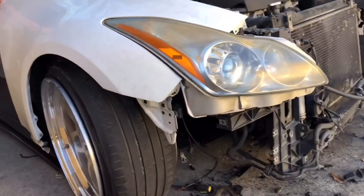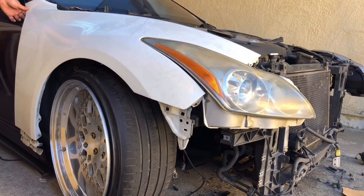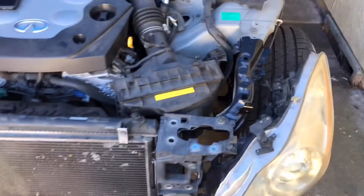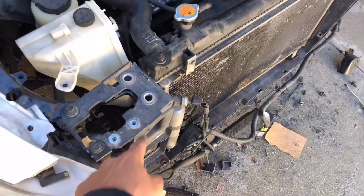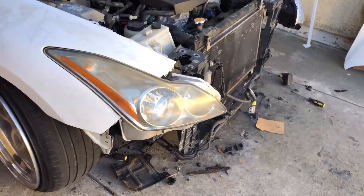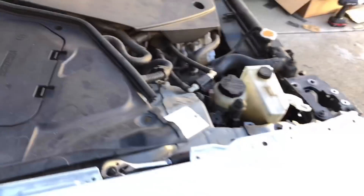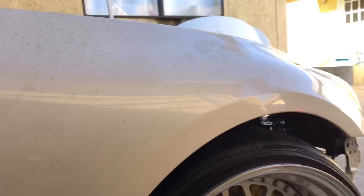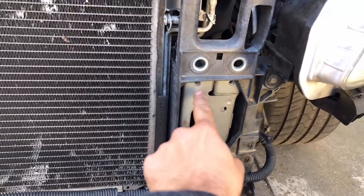Back to some bad news — look at that wheel gap. The fender is on at the front only and it's way too high. The radiator support is too high right now. I'm wondering if that's the cause. So we're going to unbolt it from down here and slide it down and bolt it up to right there — I think that's the only way.